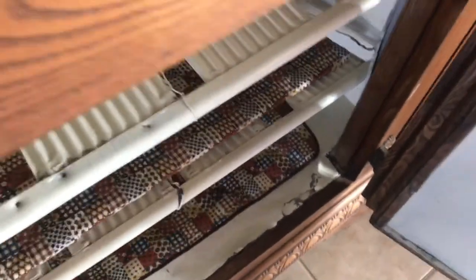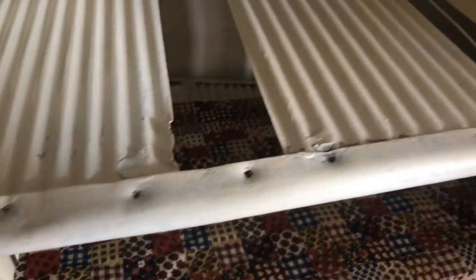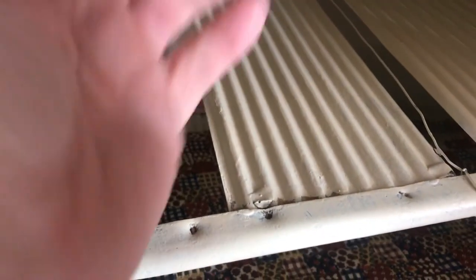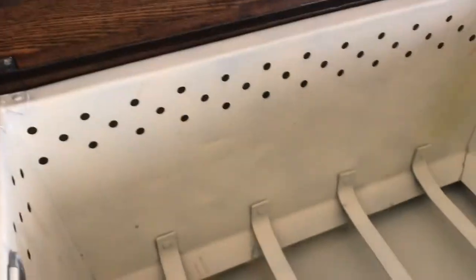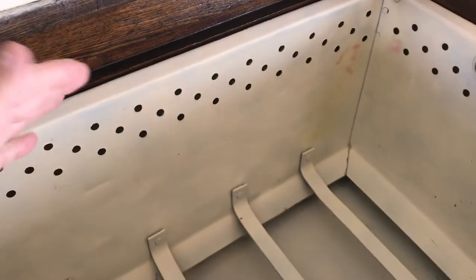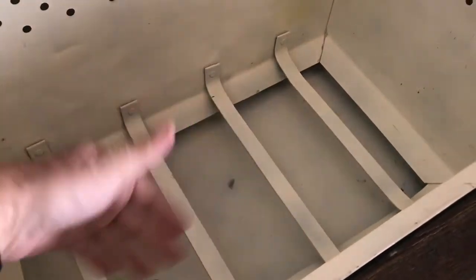The cold air would come up underneath, come underneath these louvers — that's that tray. Here's the condensate drain line, going down into this piece right here. It would drip down into the bottom, and underneath the bottom is another tube that would go into a condensate pan. The cold air would drop down out of the bottom from up here and push down through these openings to create a convection. Then the warm air would come up through these holes — basically like a return air grill — creating a constant airflow.